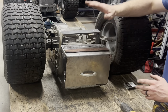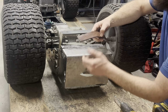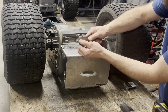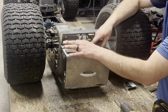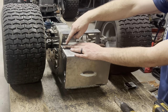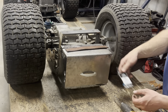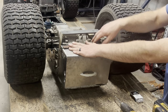All right, I got my leather strap ready to go. I cut it to length, smoothed off the edges by rubbing it on the table, and then I took a little sledgehammer, folded the belt in half, and hammered it in both directions — folded it both ways and hammered it to really loosen it up and give it some more flex so it's not so tough opening and closing. The next thing I'm going to do is drill eight holes, four on each side of the leather strap, then use a marker to transfer those holes onto the steel. After I drill out the marks on the steel, I'll put my three-sixteenths by quarter-inch aluminum rivets in there, use a rivet gun, and get that tightened down. Then we'll move on to wiring.